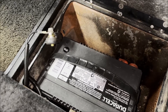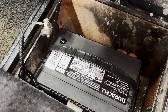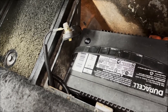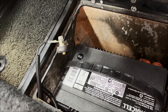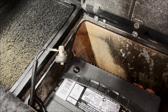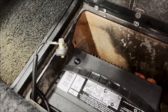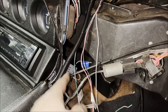For the fuel pump wiring we have three wires: red is 12 volts applied, brown goes to chassis ground, and black goes to battery ground. We're continuing the red and brown through to the front of the car, routing through the cargo area, making a turn under the console and bringing them up front. For the battery ground, it's terminated with a ring connector and shrink wrap, utilizing an extended side post battery bolt that allows you to put a connector on there.